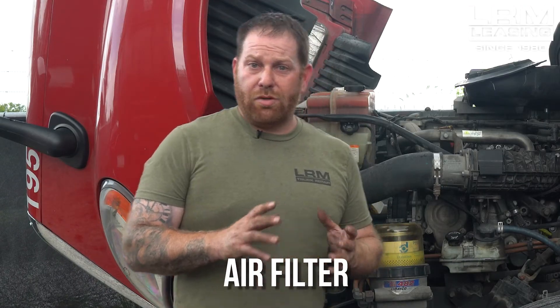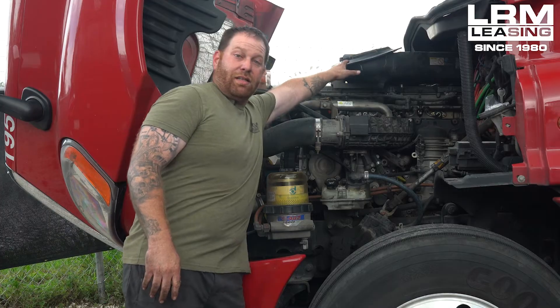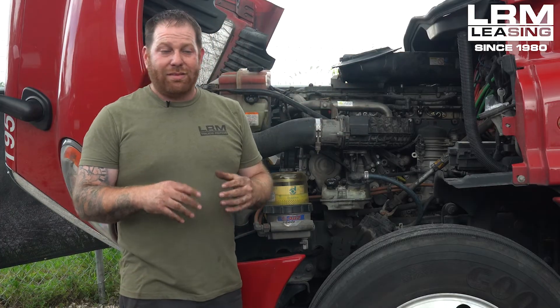So let's start with the simplest thing: the air filter. Anytime you guys do an oil change or you go into a Freightliner service or truck stop and ask for a service, it doesn't come with an air filter unless you specifically ask for it or have them check it out for you. That's the biggest thing — I find out that people forget about it. I pull the air filter down, which is right here, and I find out that it's collapsed. It can't breathe.